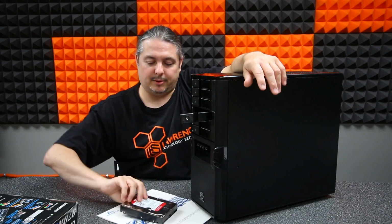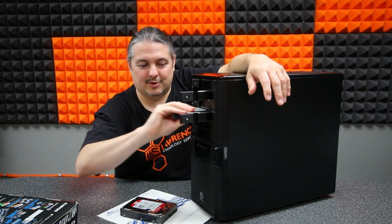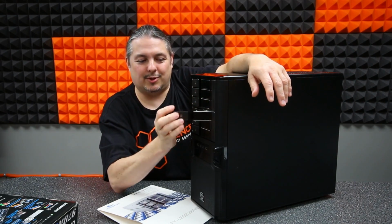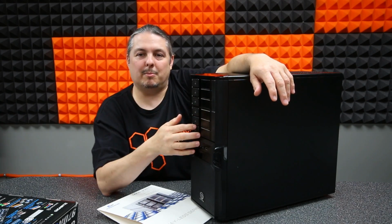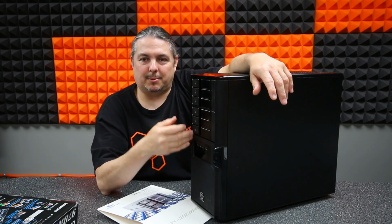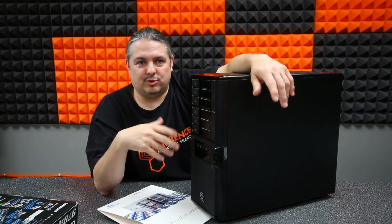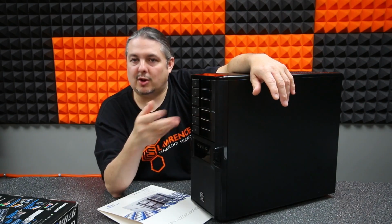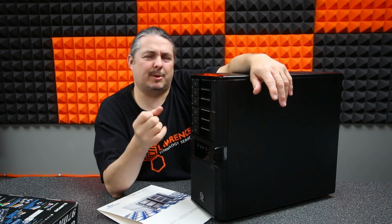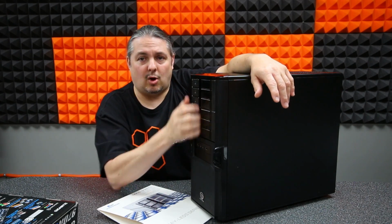Now, another neat thing about the way FreeNAS works is this doesn't matter. We can take the drives, and we're going to do a little rearrangement here, shuffle them, and FreeNAS just goes, okay. They're all part of the same array, so it doesn't have any issues. It's not even an error when it comes up with this. It finds all the partitions, it has the configuration file, so swapping the drives, no big deal. And if you have to swap one out, as long as it's the same equivalent size, you can add it right back in the pool, it rebuilds. Now, the only time you're going to have a problem with that is if you go with a drive smaller, it's not going to rebuild, and I highly recommend going with all the same drives.